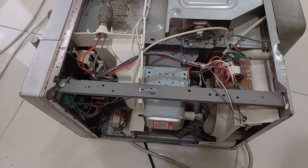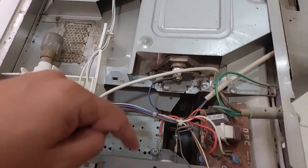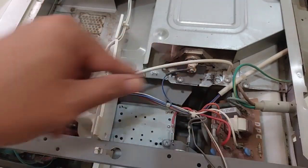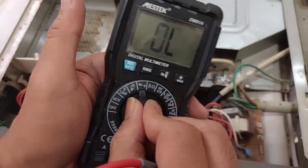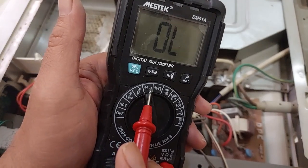Okay, this is the inner organ of our microwave oven. First I need to check all the fuses — we have two fuses here, the ceramic type. I'm checking with the multimeter using the diode and continuity test position.